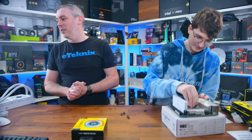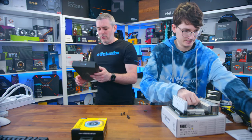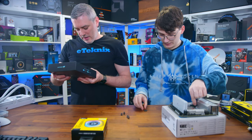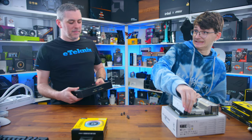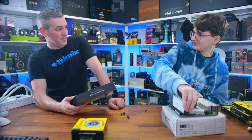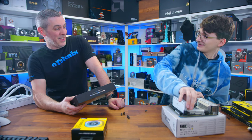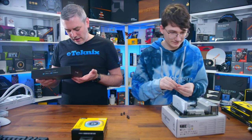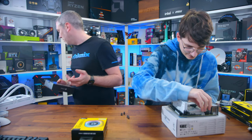Corsair have been efficient. But yeah, the DDR5, which I put down here, I didn't actually tell you guys what the spec was. I know what it is. I told you it was in my home PC. We've got a little label on there and everything. So, what is it, 7200? 72, I think it's... Yep. Go on, what CAS latency? Ooh, that's a good question. Have a guess. Do psychic transference, tell me through force? 30 something. Six? Yeah. Yep. Yeah, so 36, 46, 46, 116, and voltage 1.4. These are actually the two 24 gig modules, so we've got 48 gig in this kit.